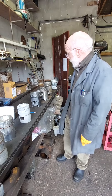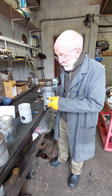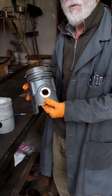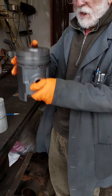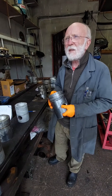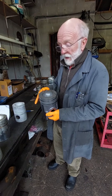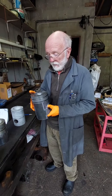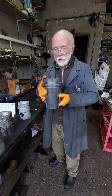Another interesting point is that the gudgeon pin is not in the centre of the piston. You'd think it would be — the piston's going up and down inside the bore — but the gudgeon pin is a little bit off-centre. I think it's typically about one millimetre, which is not very much in the total diameter. The reason for this is easy enough to explain.